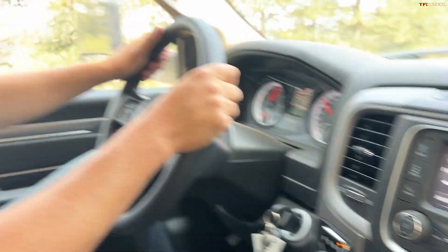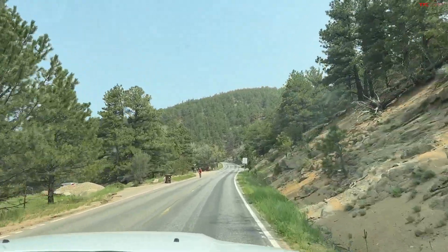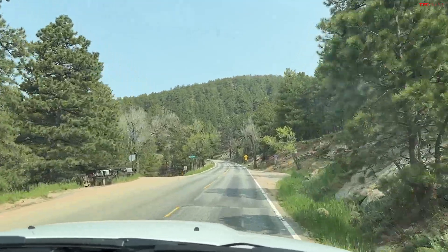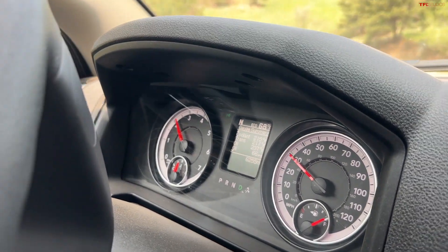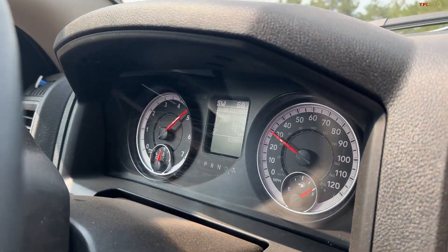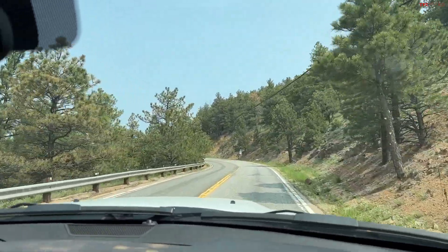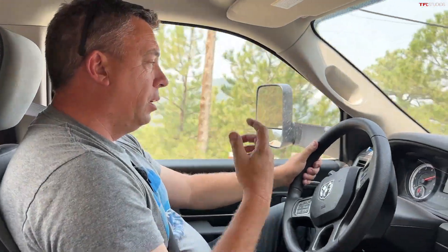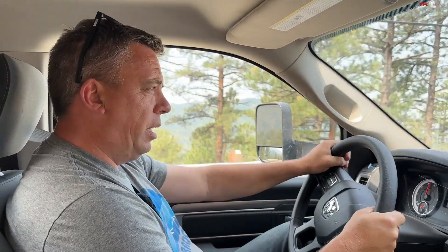For this video, I just want to show you my way up the mountain. It leveled off a little bit and it's accelerating. Ambient temperature is near 68 to 70 degrees. I'm going from about 5,300 feet above sea level to about 8,000 feet above sea level — quite a huge climb. This engine is working hard. 5,000 RPM. After 4 or 5 minutes, my oil temp is about 237, trans is about 219, and coolant is about 221. So this engine is managing this quite well so far.